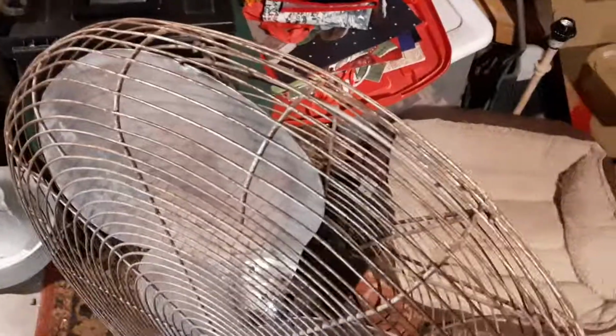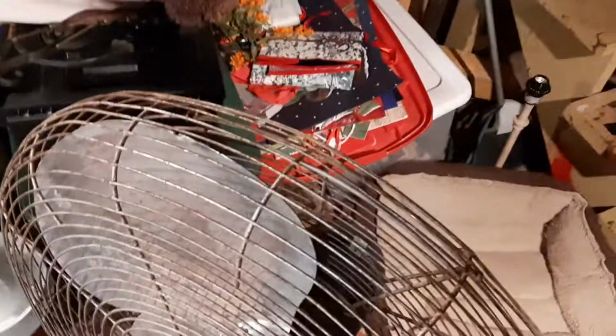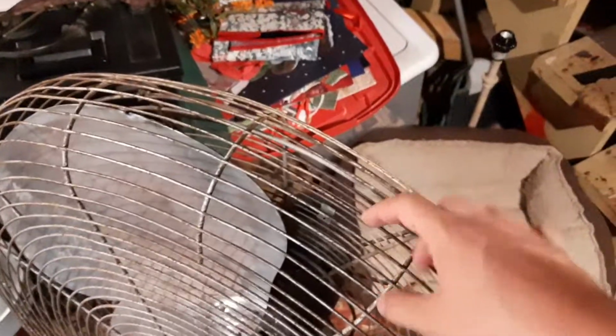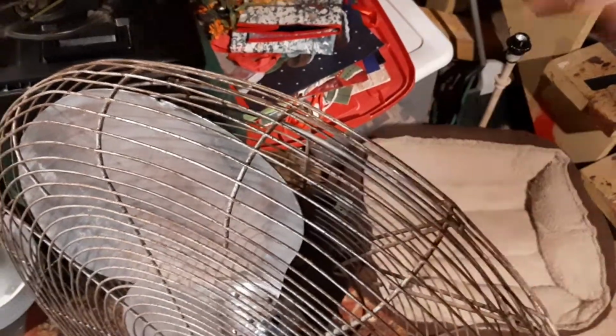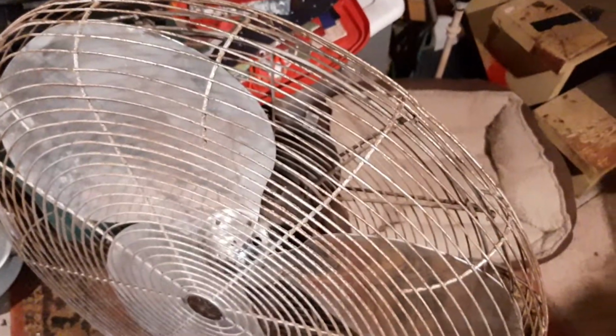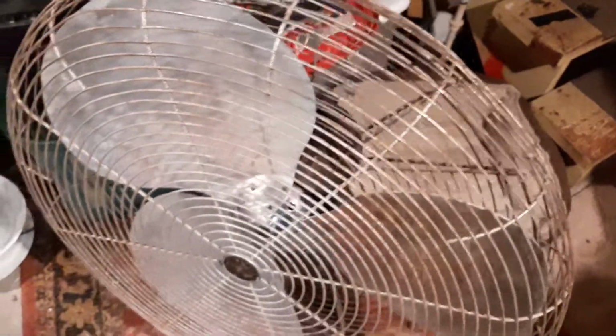The bearing holder is a little loose because when the bearings seat in the housing, there are two springs that push them together so that it has pressure. But the blade was really off balance, and they ran it with an off balance blade forever, so it's a little worn in there. I put some grease around the bearing so it wouldn't be so loud. When you're running it you can't hear it, but when you're starting it up you can hear it.